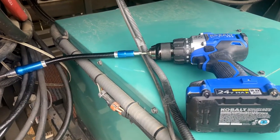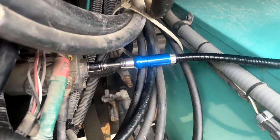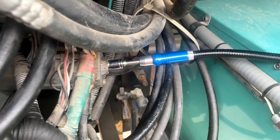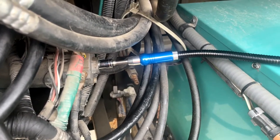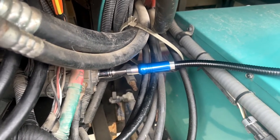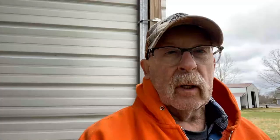Here's what it will look like if we're going to pull this up manually: the drill turns the flexible extension — we can position it any way we want — then hold the socket end on the motor and just spin away. With somebody holding the button down for auto retract, it should pull the jacks up. That's how you do it manually. I'm also going to put a link in the comments to another video on a Thor motorhome — everything's in a different place but it's pretty similar, so it'll give you an idea of what to do in an emergency.